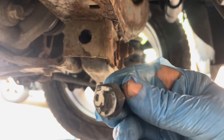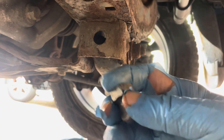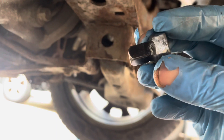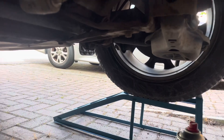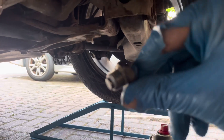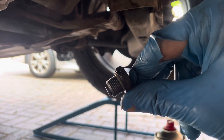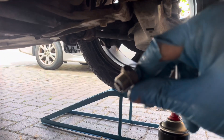You've got to make the tool yourself. I bought a cheap square drive from eBay and welded it to a 19mm nut — it's just long enough. You have to be careful it's not too long, or it can't fit up there. Then you just need a cheap sump plug; I bought one with a magnet in it. Obviously get the right tap and a copper washer. It hasn't leaked a drop.